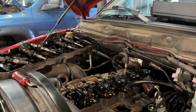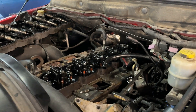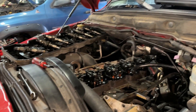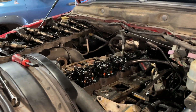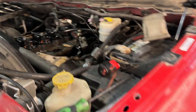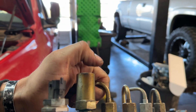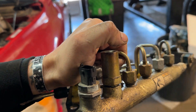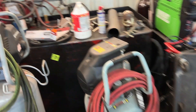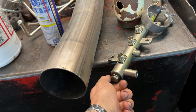This truck only starts on ether — low rail pressure. With the FCA pulled, rail pressure was only getting to about 14,000. But if you ran it on starting fluid it would start; it was just very low on power. These injectors have been in less than a year, so we're getting it set up with new injectors. If you look at the rail here — I haven't cleaned it yet — there is this valve right here. This is your relief valve. On a 5.9, on a 6.7, your relief valve is going to be located right here on the end, where your intake horn is.